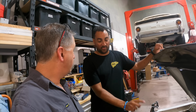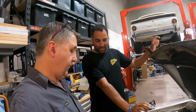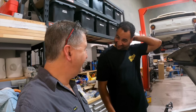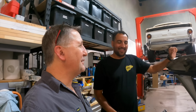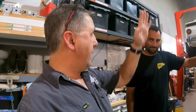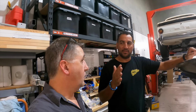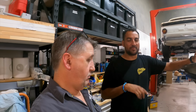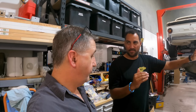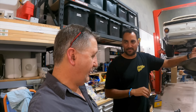So got that, and then we can do whatever other buttons you want in there. I thought what might be nice is a throttle aggression setting, because driving this with those throttles might not be the smoothest. That's one of the beauties of the Haltech, we can do that ramp rate. It doesn't have to be linear. What would be nice, I think, would be 4 different levels of aggression. Track level, yeah, spot on. Give me what I want to drive on a Friday night, and give me what I want to drive on Sunday, so I don't shock the old ladies up and down Macquarie Pass.